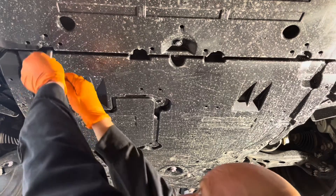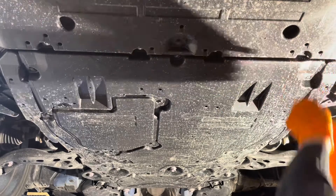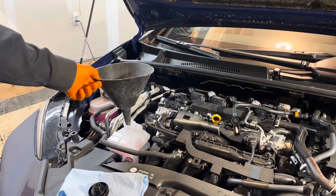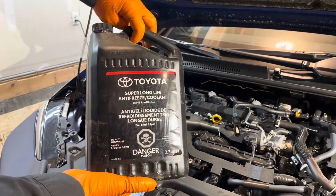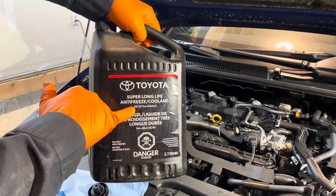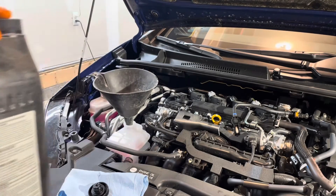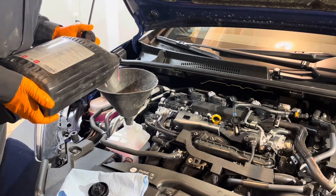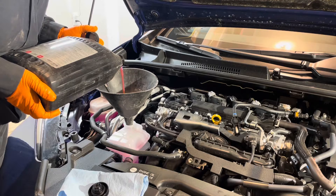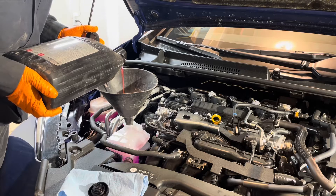You can just double-check them with a little wrench. Alright, that's good. Install a funnel in the inverter coolant tank and then refill with genuine Toyota coolant. Depending on your area, you may either get the 55-45 or 50-50 mix. Here in Canada it's a little more concentrated because it's really cold here. Then start filling it up nice and slow, and you can fill it up full.